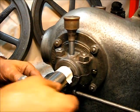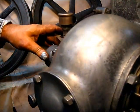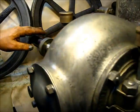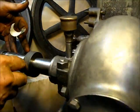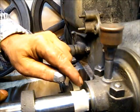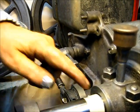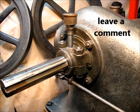What I'm going to have to do is put the flywheel on this side right here, and I will use this side over here as the side to set that flywheel fast. Then once I get everything in position, this will be the alignment side. If you pull it this way, you've got an eighth of an inch clearance there, and when I get ready to put it back on, I would set it at half that distance. Now that we've got past that, let's hold that flywheel up.